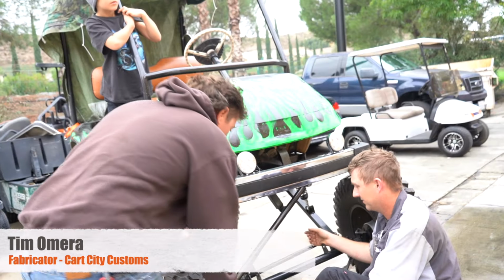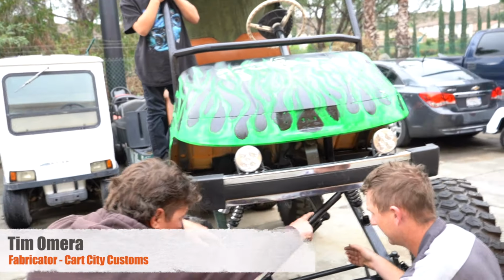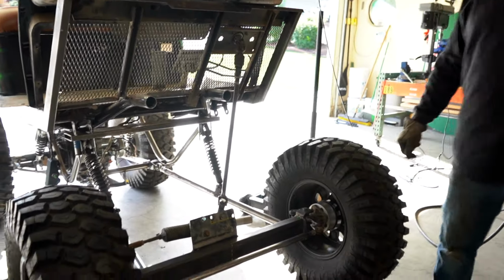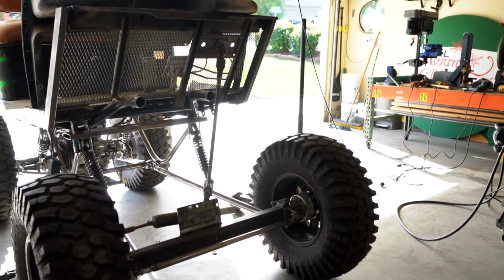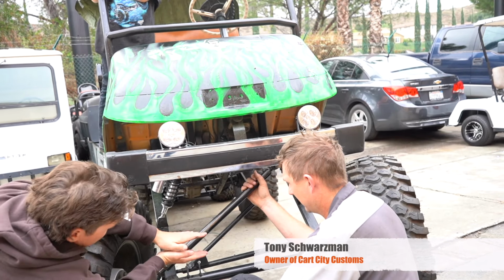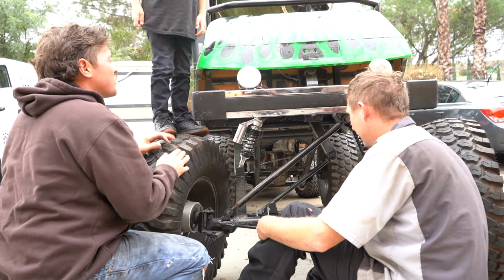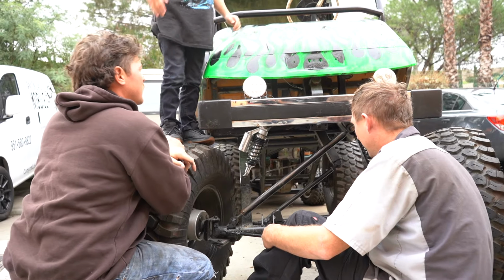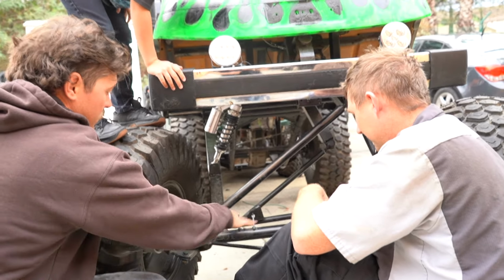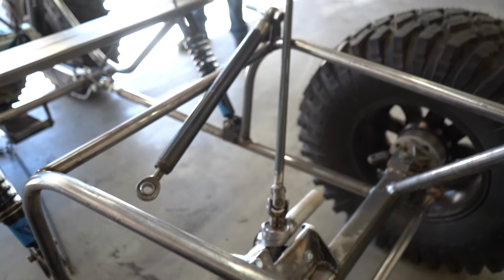Panhard. So this is like a panhard style setup, and it's so aggressive. This should be a nice J to keep it square versus this. This would work if it was like 15 degrees or less, not this monster 30. Everything's just been extended and nothing's braced. No. These tabs are cheap. It'd probably be better just to cut them off, put new ones on, and go from there.